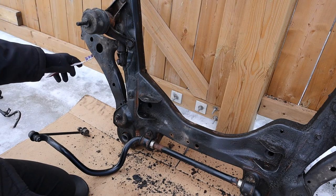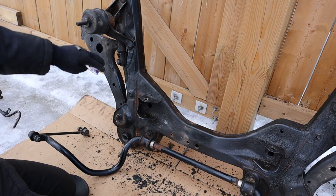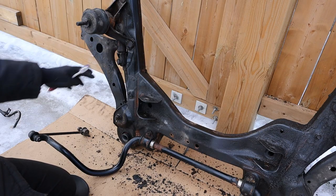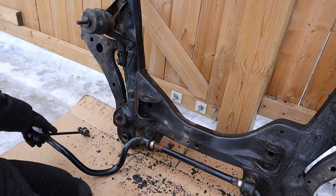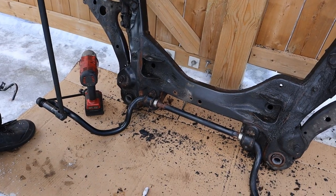This is an excellent time to change out these control arms because the bushings are a little bit worn, and you have to remove the engine and transmission mounts in order to get to these bolts — it is a really stupid design, so doing it in the car is a lot more difficult. I am also going to be changing the sway bar bushings because I have access to them, as well as the end links. Let's see if the breaker bar will get it.